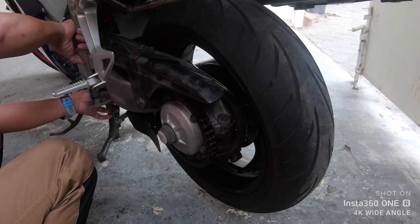See the play? Stretched, compressed, stretched, compressed. This will happen unevenly — some links have play and others don't. That's exactly why your chain will have a slack area and a tight area at different points around its length.